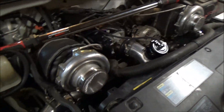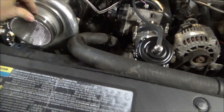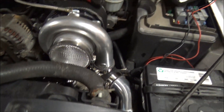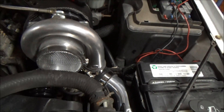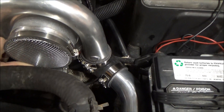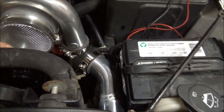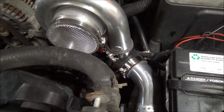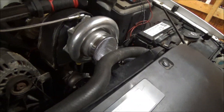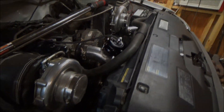Closing shot — literally, I put the camera down. This one took me a few minutes to build because of the fact I was filming everything. Put the camera down, pounded this one out, timed it. I had this one done and on the car in less than two minutes. Of course, I already had the silicone cut, so that saved some time. But literally — tin snipped out the screen, traced it, tin snipped it out, bent around the edges. Boom. On the car. Done. How to build your own screens in a few minutes for about a tenth of the price. Enjoy the video, guys.